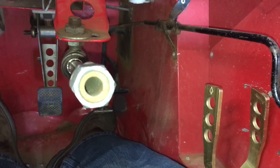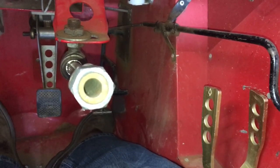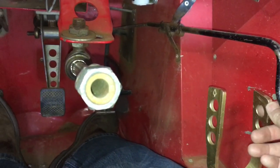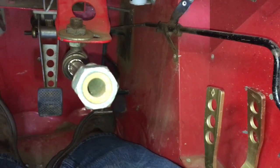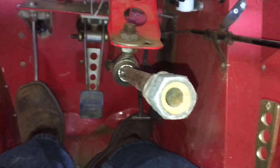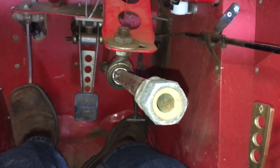Of course, if the car gets spun out and you need to get it back into neutral with the engine dead, you may have to bump the starter a little bit and push the lever forward at the same time to get it out of high gear. That way you can fire the car again, start in low, and roll the car by pushing the clutch in without slipping it too much.